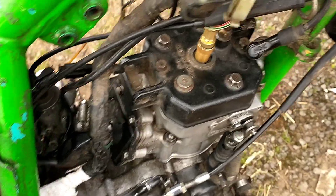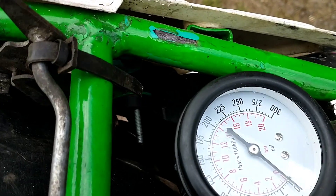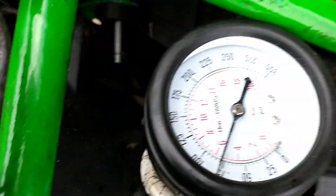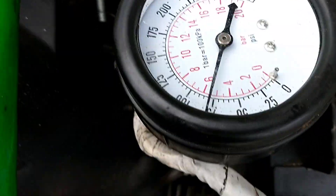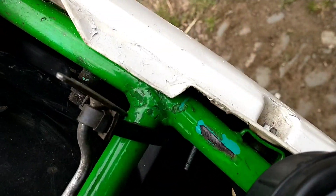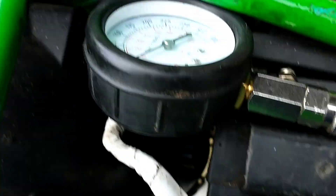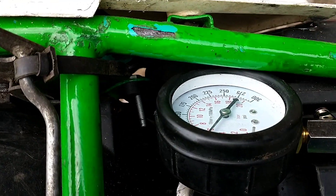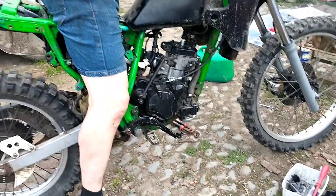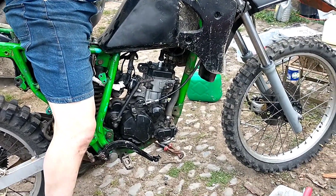I know I've got a worn cylinder and I've done just the basics, but let's see what we can get. We've only got up to 75 to 80 — it's better than it was, but that's still not good enough really. It might run at that — moment of truth. It's definitely a case of the cylinder needs replating.